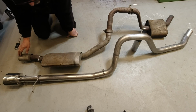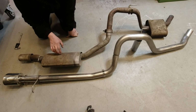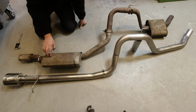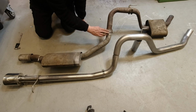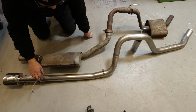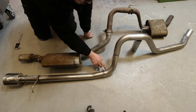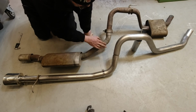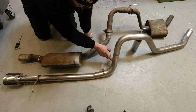So stage 1 on the original has got a couple of kinks in it, a curved resonating tube, perforated tube coming through here, kink in it here, here and stop. The Adamesh system is obviously almost entirely straight, has no silencing whatsoever, and is also mandrel bent, so whenever we've got a curve, the Jaguar system reduces in size. This does not.